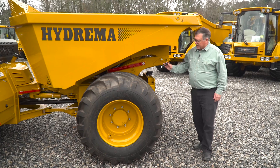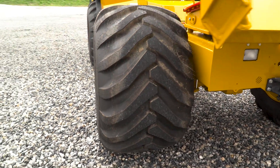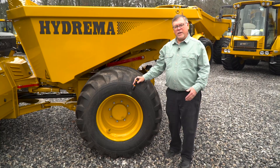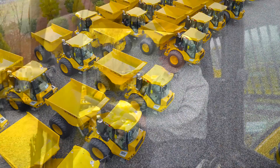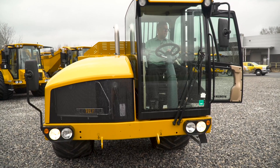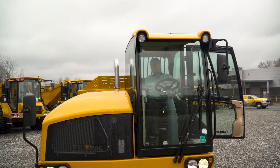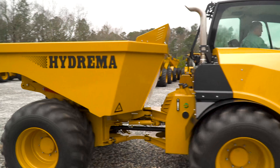Every day we want to walk around and check each tire visually. Make sure that the treads are good and there are no nails, punctures, or tears on the tire. At the end of the week, we want to make sure that we check the air pressure in each tire. From the driver's seat, I want to check the positioning of my rearview mirrors and make sure that my rear camera is working. I'm going to look at all the glass to make sure it's good and solid, not broken. Remember, all the steps we've talked about are included in your operator manual. Make this part of your daily routine to do these maintenance and safety checks and you'll get many years of great service from this truck. I'll see you next time.